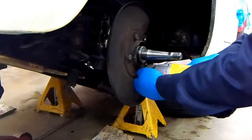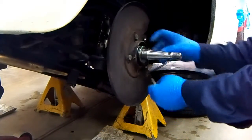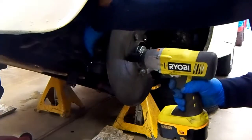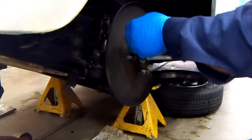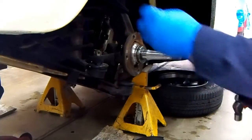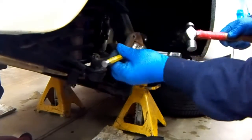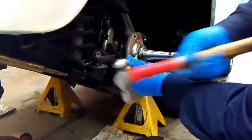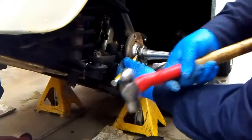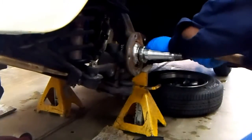The pain here is it's going to take your steering arm off too. Just in case this doesn't work, we're going to be able to put this back on. You could use a pipe wrench, grab it with a pipe wrench and spin it off, which is probably one of the easier ways. But I don't want to screw up the seal surface and have to fight with it too much.